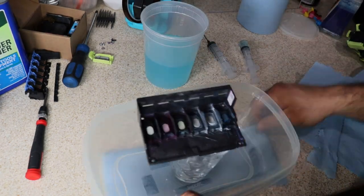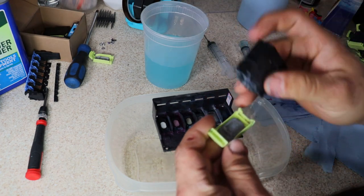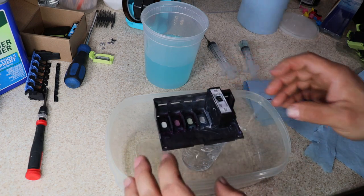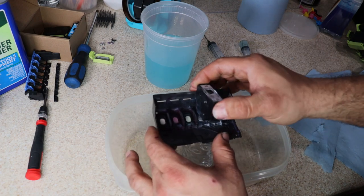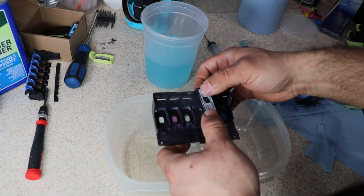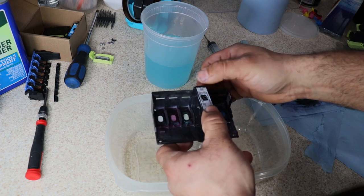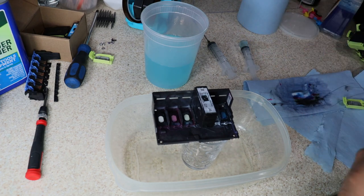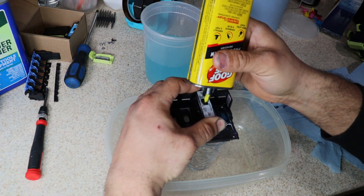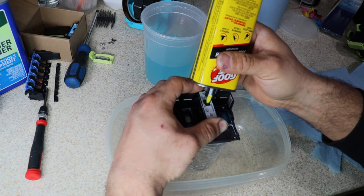Now for the moment of truth, and this is going to be a lot of controversy. I'm going to use the Epson original — it's one of my spares, I don't use this one. What you want to do is make sure this slit actually goes into the hole. I'm having a lot of issues on this one with the red, so I'm going to focus on that one. Because you don't have anything in here, you're going to have to actually push down on this and push pretty hard. Just make sure you don't damage anything on the printhead. You're going to push down to get a good seal because you're going to push a lot of solution down.